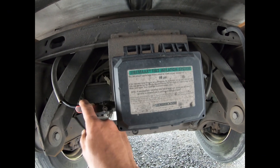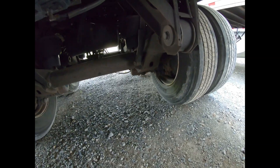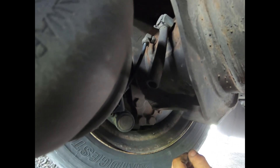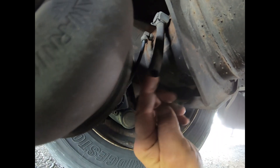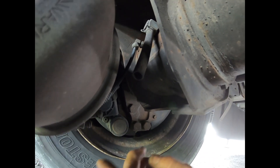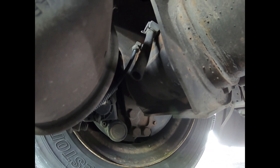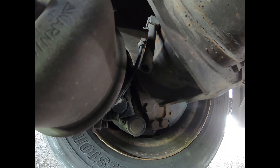So we're going to open up this valve, and you can hear an air leak coming out by the wheel end. We can see it's coming out of this axle drain right here. This axle drain — you can see it's mounted on the side — this isn't to drain moisture out of the axle. This is to drain air pressure in case there's a leak inside of the axle or the auto inflation system, so you don't pressurize the axle and blow out a wheel seal. Don't ever put your finger over here and close up the air pressure, because air pressure is going to build up in the axle and it's going to give on the only place it can give — a wheel seal or a hubcap gasket.